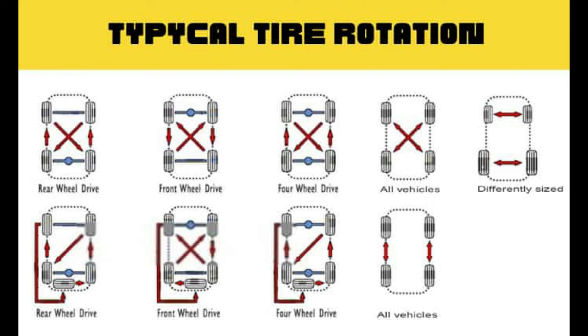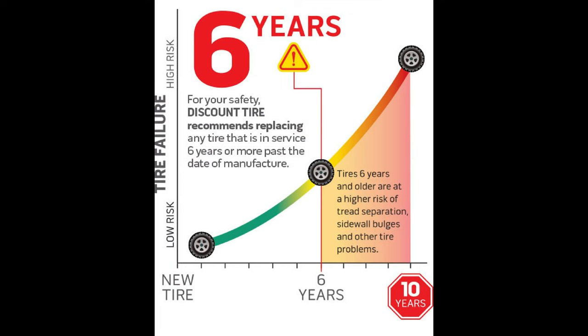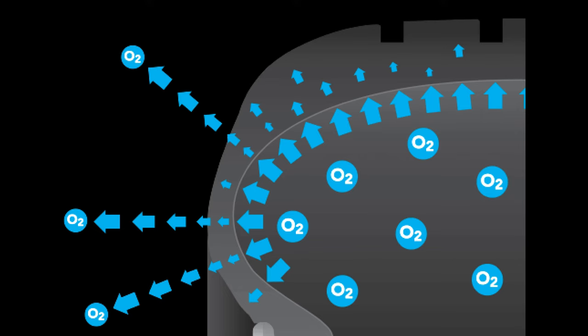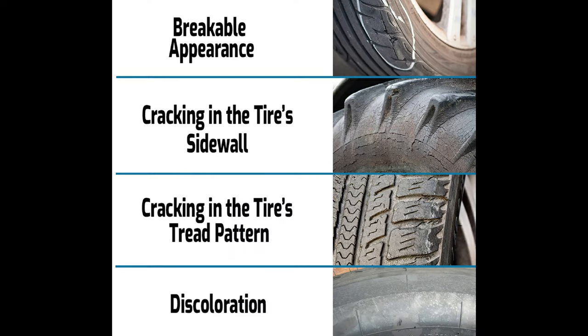That leads into the matter of tires degrading over time. There's a safety limit of five to eight years, depending on ownership and circumstances. Rubber deteriorates from exposure to oxygen, ozone, sunlight, and road stresses. There'll be signs of dry rotting, cracking, and significant color fade. If you leave your vehicle outside with unstable temperature fluctuations, as is widely known across the upper United States, that's going to speed up the process — you're going to be at that five-year line.